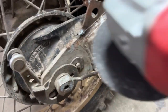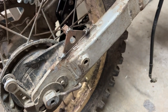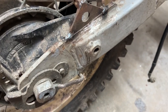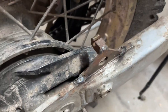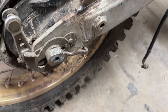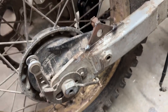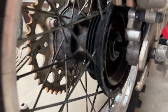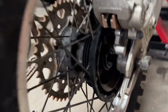I'm going to start by grinding off this little mounting bracket for the rear brake cable. I'm not positive this one is stock — looks like somebody made it up and tack welded it on and it sort of worked. I did everything I could to get some braking power out of these rear drums and it just wasn't for me, so that's why I'm going to the disc. I pulled the drum brakes out and put the rear axle back through.